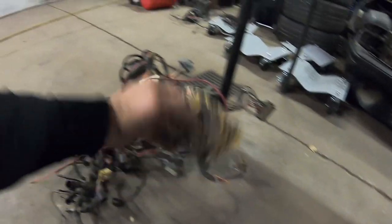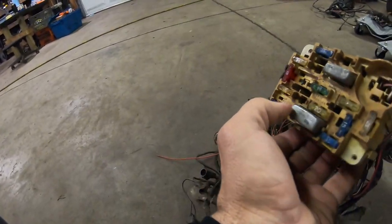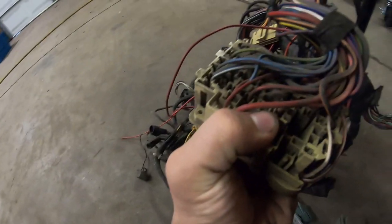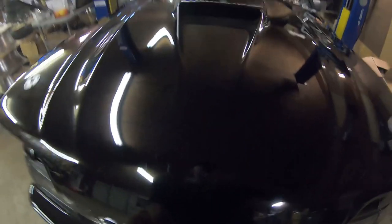My number five fire safety hazard — and this is a 1989 dash harness — is the fuse box. You can see how old this fuse box is. Over the past 30 years, many of us have tapped into the fuse box to run a radio, a hot wire, a key-on ignition source, just about anything. The more power we get to our fans the better they work, the more power to our fuel pumps the better they work — but that fuse box gets pretty overloaded.